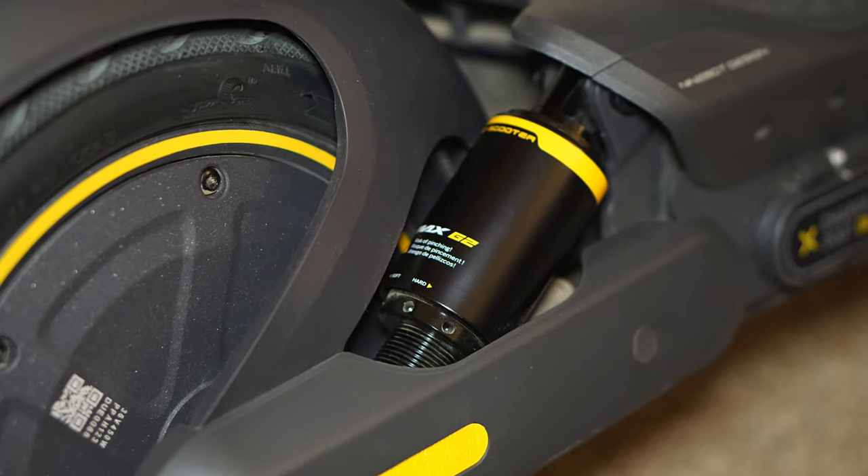One thing to mention about the suspension: it has coil springs in the rear, so if you're riding fast and hit a bump abruptly or ride over a deep crack in the asphalt, you may hear the back suspension recoil with a thumping sound. You can soften or harden the suspension to your liking, but my recommendation to Segway for future iterations is to add rubber dampening to reduce that abrupt recoil. Also, if you ride in rainy conditions and those springs get wet, they can develop a squeak — just wipe it down and apply some lubrication and it goes away immediately.